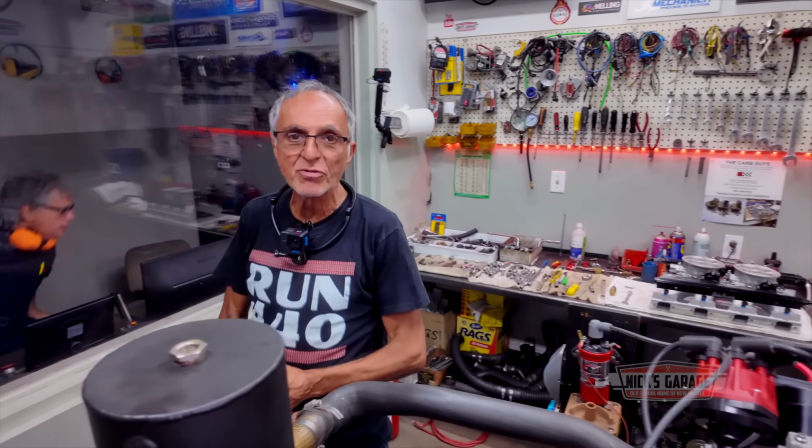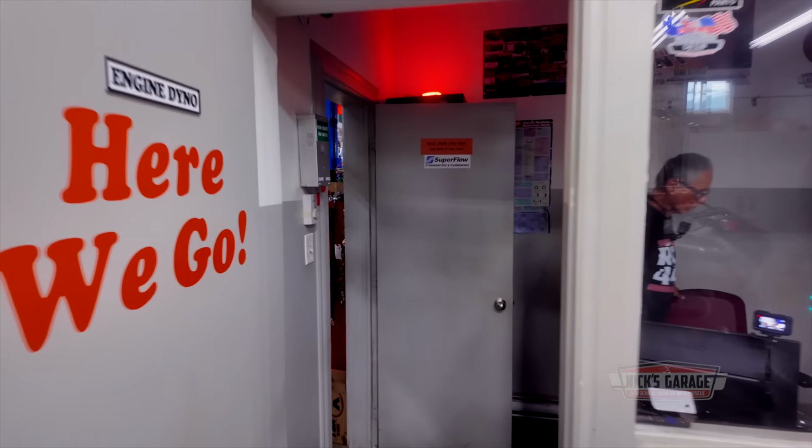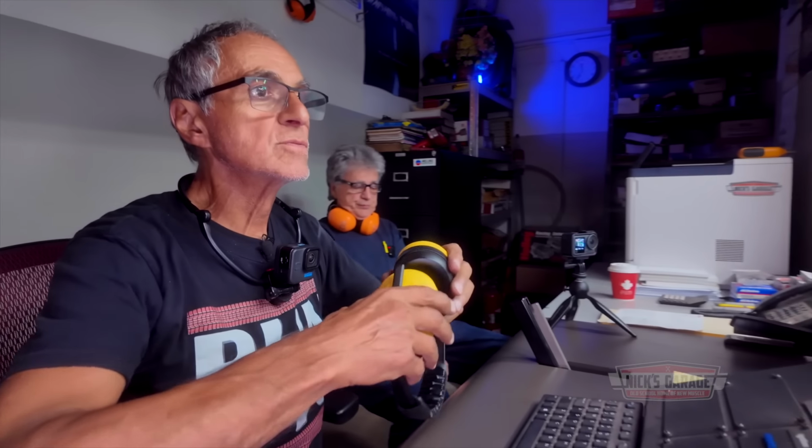We're going to make another test. 32 degrees, and this is a locked-in distributor. We got 32 degrees, and let's try it again. Do we need to go to 6,200 RPM? No, let's stay where you are now. Don't move. You want to see how it's holding the power? It's holding it very well too. Don't change anything. After we do the fuel injection, then you can cut it down.